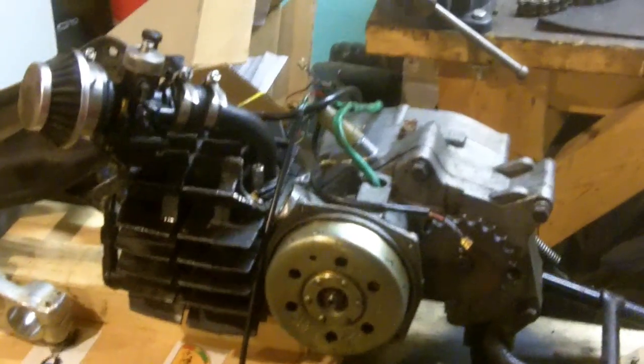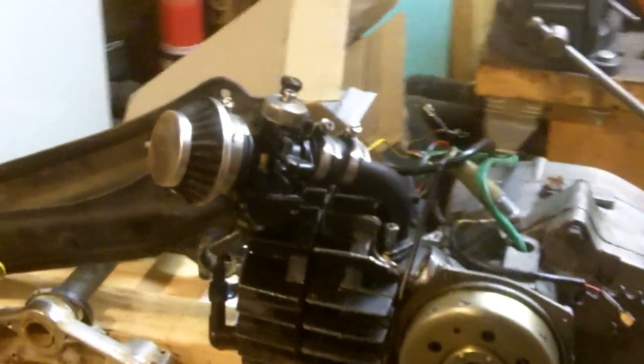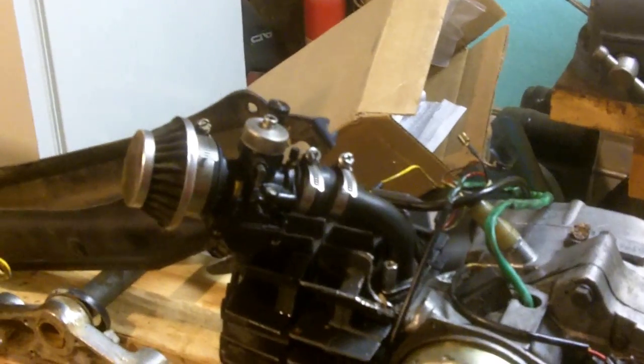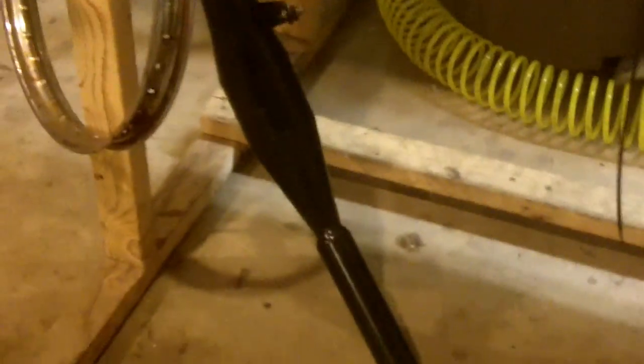For the engine, I just picked this up. This is a Puch ZA-50. It's got the Treats CDI 80cc kit, a 21mm Dellorto PHBG carb, I think that's a Mike Thomas intake, and a Motion Left Rev Run pipe.